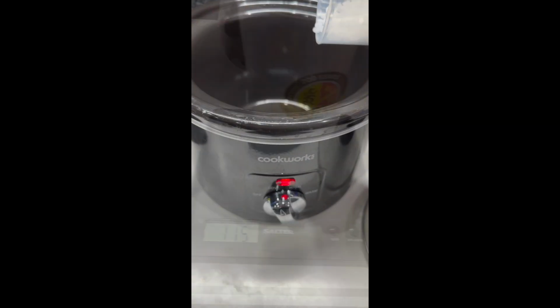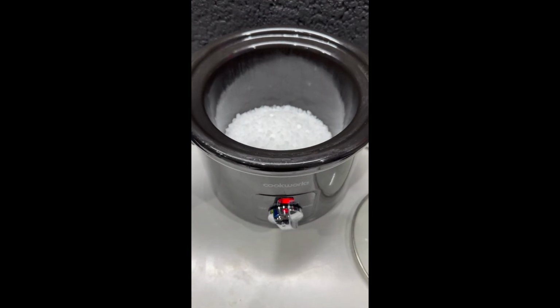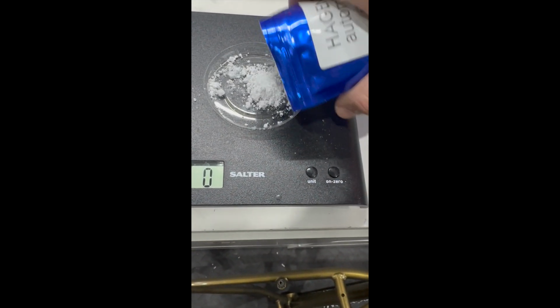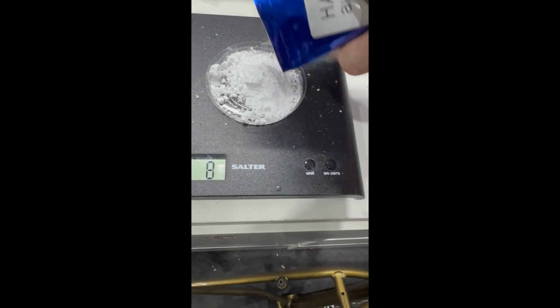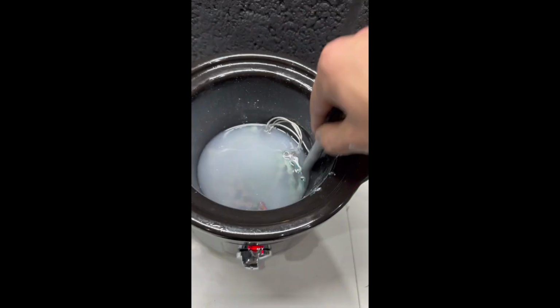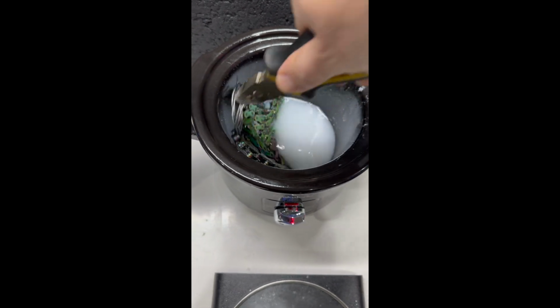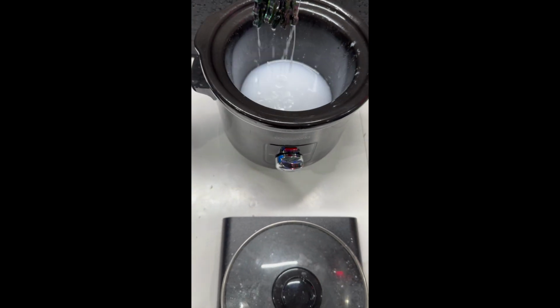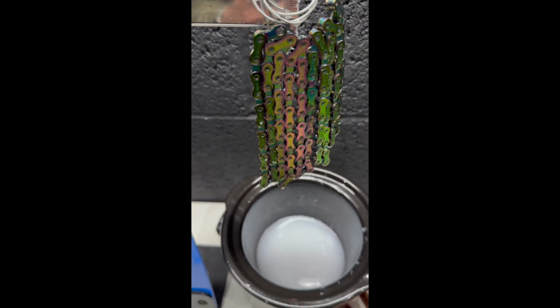And this is how I make my wax. It's just pillar candle wax. You can get this from many hobbyist stores in the UK, and I mix that with a combination of PTFE powder to give a real slick and weather resistant chain. Once you get it waxed and cleaned, cleaning's the hard bit. The waxing is very easy, and it stays clean for a long time, and you probably get 200 or 300 kilometers of riding before needing to reapply afterwards. Can't recommend it enough.